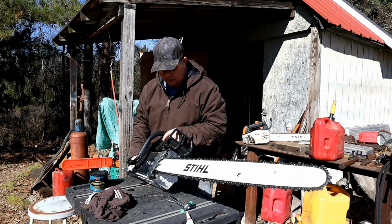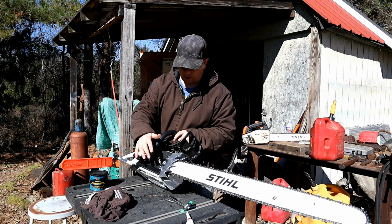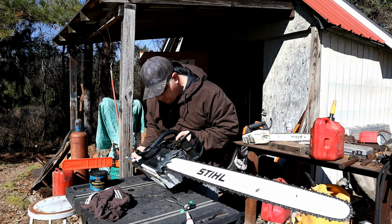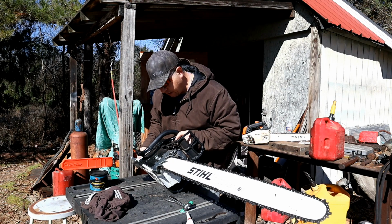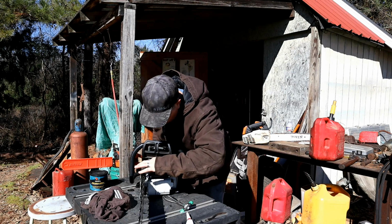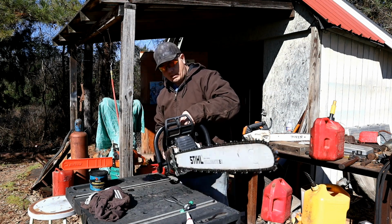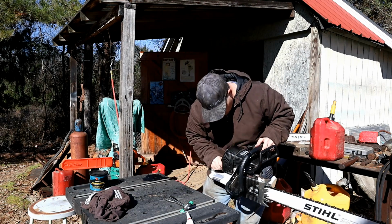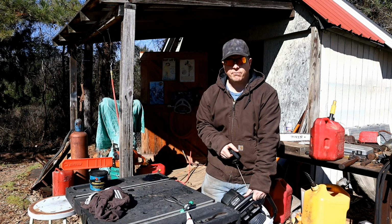Oh, I did do one more thing. I upgraded the bolts right here for the dogs. I upgraded those to a regular M5 hex, or Allen-headed, black, and then Loctited those, and then went in and re-Loctited these also. So, let's choke it, fire it up here, and see how it sounds with that new exhaust modification.